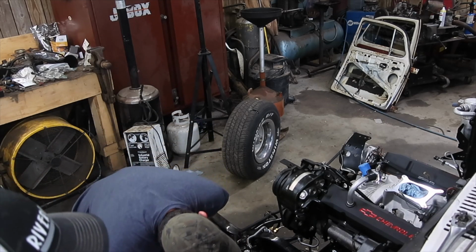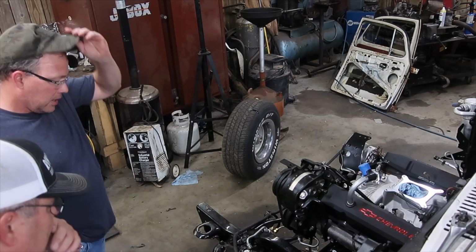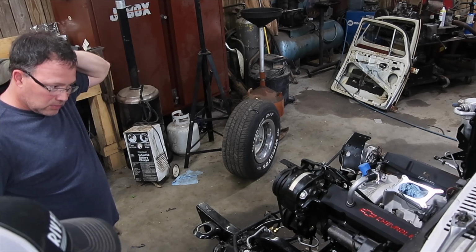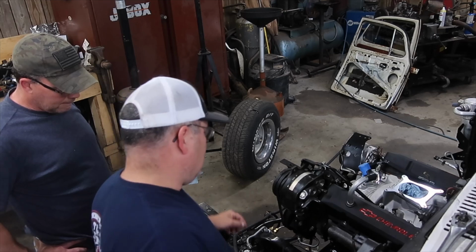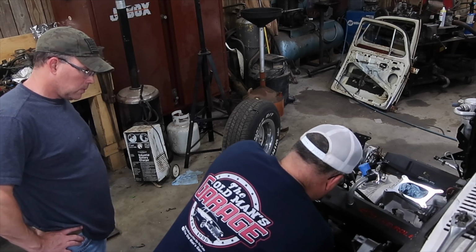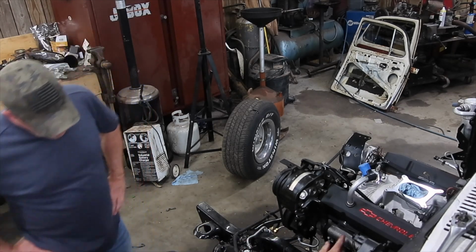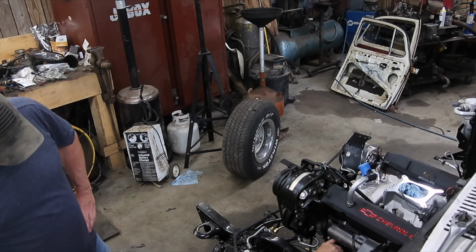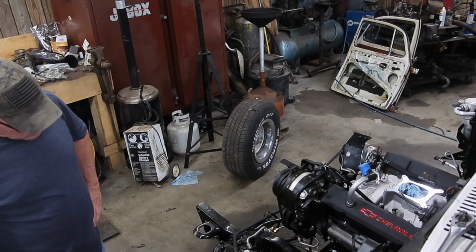How did it run before? I don't know. Remember, it wasn't connected. It was just dangling. You can't lay it right there against the manifold, I know that. I've got enough wire, which I can always add to. I could run it all the way around and come back around this way. Or what I could do is tie it to this. That's what I'll do. When this spark plug wire comes down to right here, I'll just zip tie it to this spark plug wire. That way it's not up against the manifold. But I don't want to put spark plug wires on it until the end.